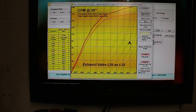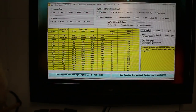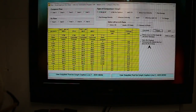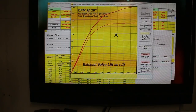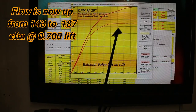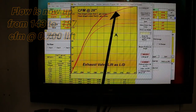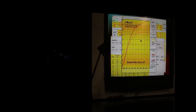Here's what that looks like in real life. Again, let's check this against number one so we can see just how much we've gained. Here's our test five versus test one — a pretty sizable gain in flow. Valve lift will be about here typically. So we've achieved all that, although we won't necessarily use it all.